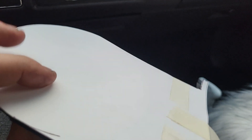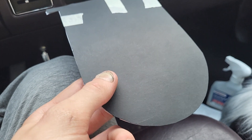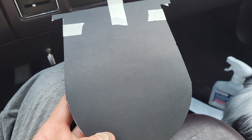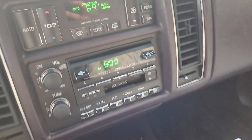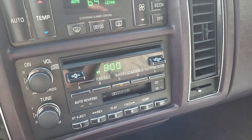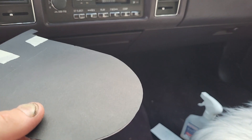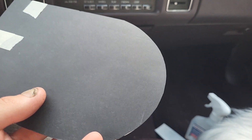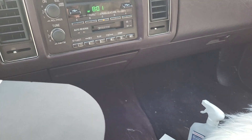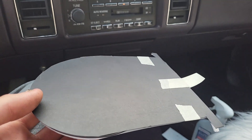The paper I had on top kept jamming it because it was too thick, and the player recognized that. So you might want to avoid using that paper layer. After doing this, wait a few minutes for the slot to dry out since you've just put alcohol in there — it needs to evaporate. Once it's had a minute or so, stick a CD in and see what happens. If it still doesn't work, clean off the device and try again with fresh alcohol. If you've done it more than three times and it's still not working, the roller has likely separated from the rod and you'll need to disassemble and replace it. I have optimism this is going to work, so I'll note in the description whether it did or not.